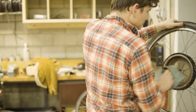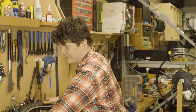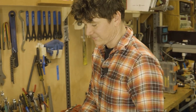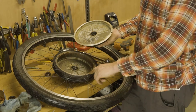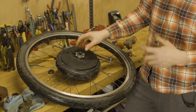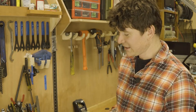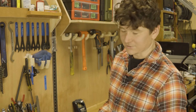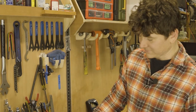You might be wondering how all this water got in the motor in the first place. Of course this is Vancouver and this motor has been ridden all winter long, so it has tons of water exposure. There are basically three avenues on these direct drive motors for water ingress. The first and most obvious is the motor side plate seals — when this motor is put together there's a large flat surface linking the rotor with the magnets to the side plate, and they usually apply some kind of sealant or silicone material prior to squishing that down. I can feel there's a little bit of gummy rubbery texture in there, so I suspect this one was decently well sealed, but there are cases where there are just gaps in that seal or it's omitted completely.